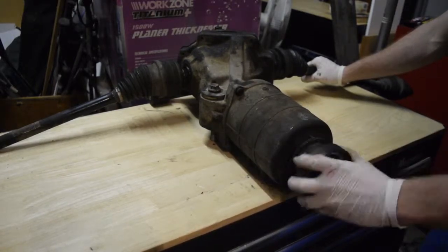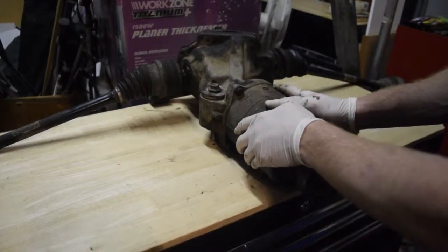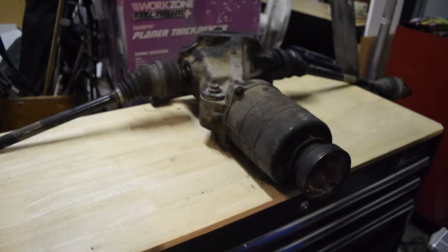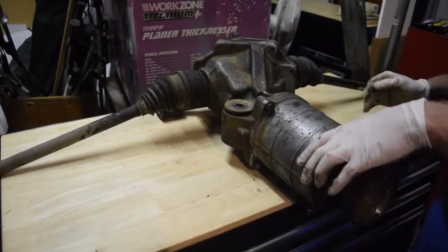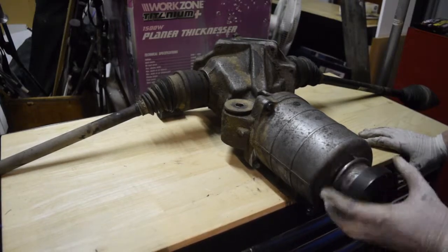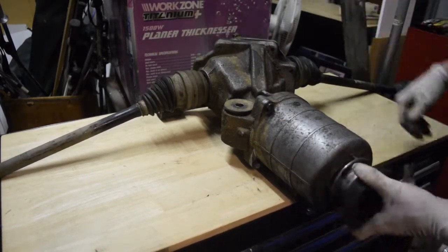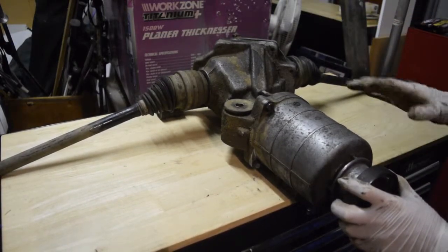So those are the symptoms of a busted Volvo V70 Cross Country or early model XC70 viscous coupling that has blown. Here we have our functional viscous coupling. The only difference in setup is the drive shafts are pushed the whole way in because it's going straight back in the car. If I turn the input, it'll turn these drive shafts the same amount, equally — whereas before, when I turned the input, nothing was getting through. So this is definitely working.